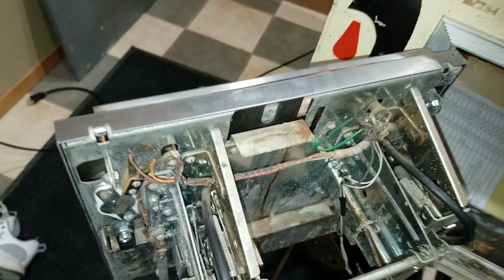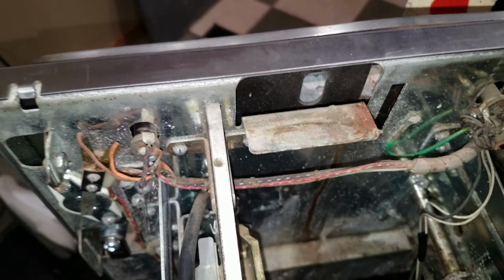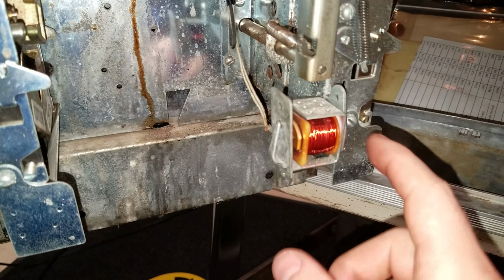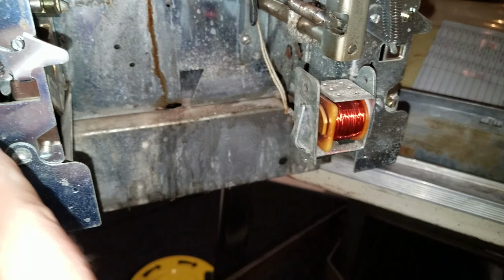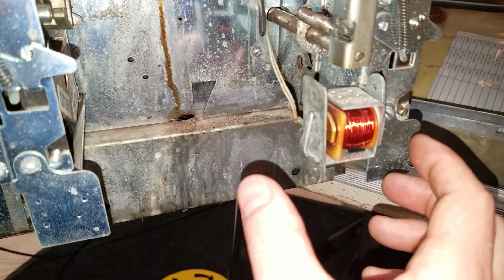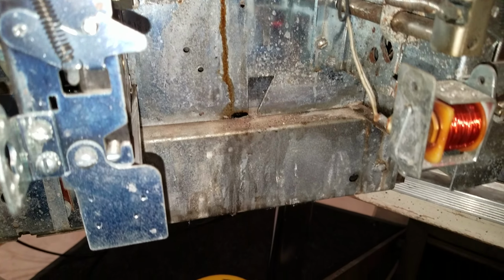Not sure if we talked about this before, but there are some reliability things that you can do with these coin doors, to defeat some things that might cause you issues down the road in a home use environment. This is the lockout coil. When the power is off to the game, there's a little rod that goes between these two, and then there's a little wire pin that goes in both of these and makes the coin mechs automatically reject a coin unless the game was on and this plate was over, and then it would be in the position where it could accept the coin.